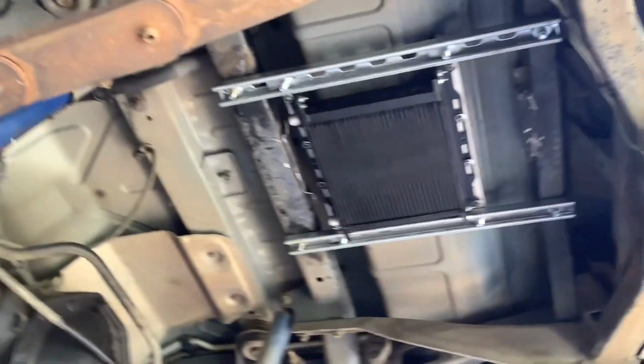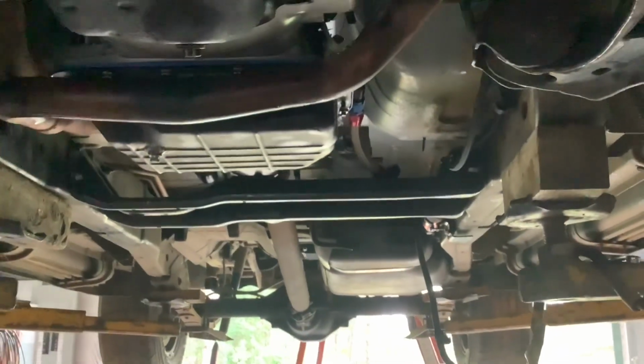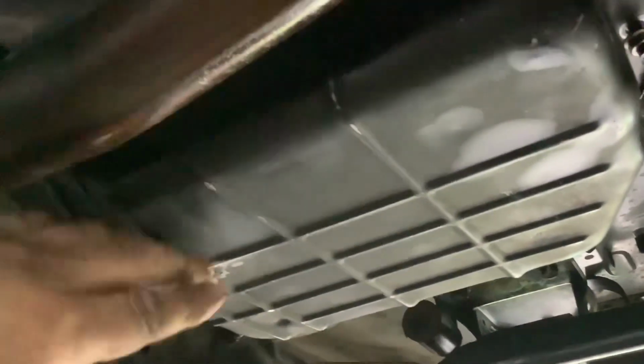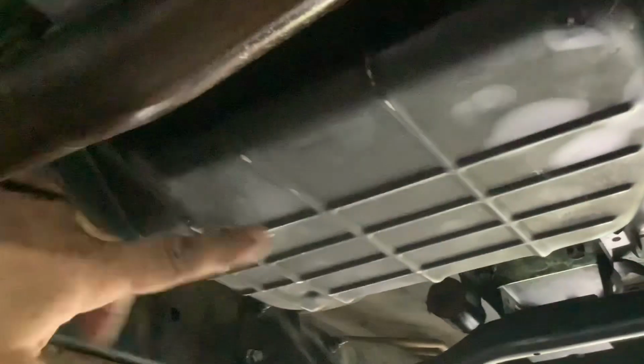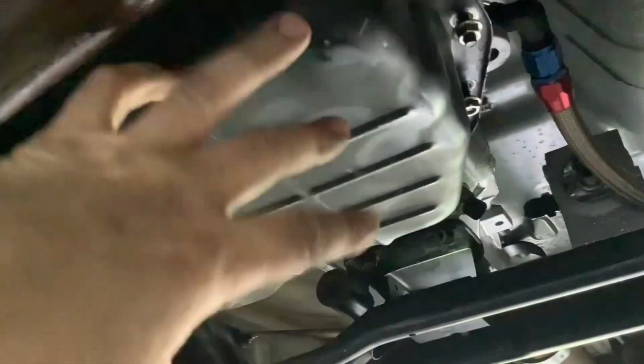Alright, I'm going to be mounting the filter and then calling it a day because I got to do some running. Okay, boys and ghouls, this is what I've got. The transmission, I added a drain plug, and when you have a drain plug in a transmission pan, it's just to drain the fluid, okay? That's so the pan's easier to take off. I put that in there so I can just pull the pan, inspect it, change the filter, you know, make life a little bit easier, okay?